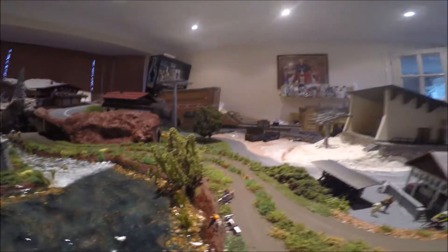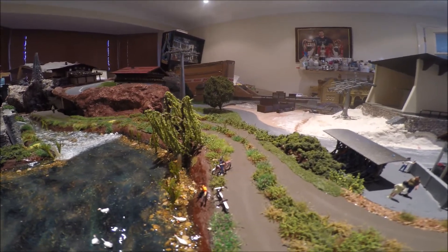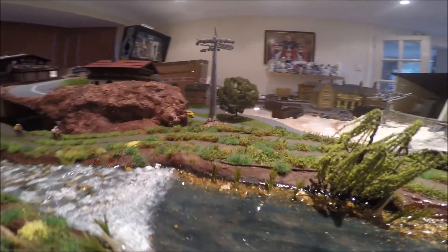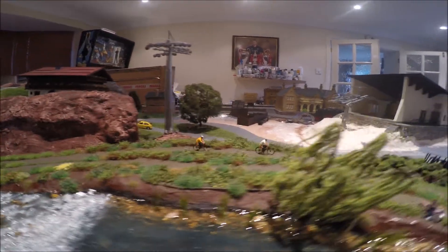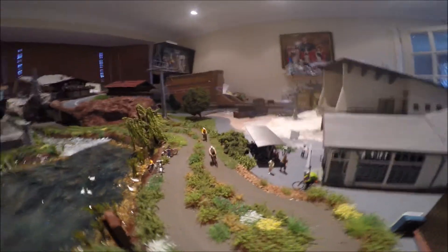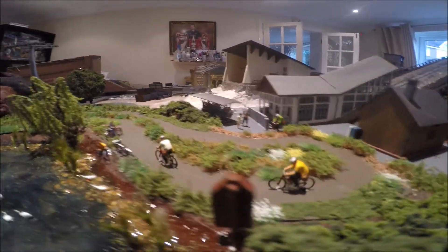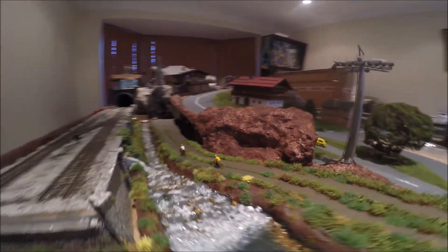I tried to decrease the noise from it but I've been unsuccessful. I've wrapped the motor in a thick cloth, I've packed out the area around the cogs and the motor with some foam, and I've also put some WD-40 on the motor as well, being careful not to touch the cogs or the rubber rings, but unfortunately none of that has fixed the noise problem.